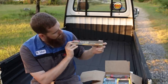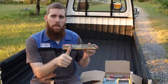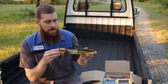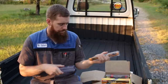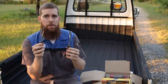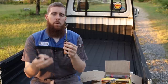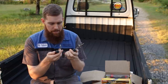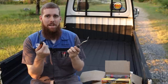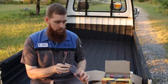This is a two-piece set of clip tools for getting those stubborn push pins — the little pinecone-headed-looking push clips that are flat on the top — for interior components or wheel well housing. They have elastomer handles on them. You've got two different size tips: a smaller one for tiny fasteners, like a lot of Subarus have for their interior components, and a bigger tip for larger plastic push pins you'll see on underbelly trays, wheel well housings, front bumpers, rear bumpers, etc. Pretty neat little set with a nice non-slip grip.